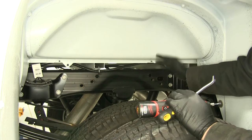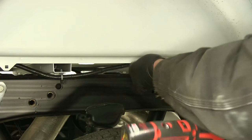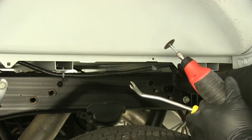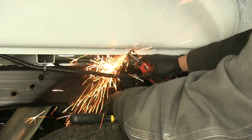We need to make a small notch here in the rear passenger side fender well. You'll see there's kind of already an area where there's just one layer of steel — we're going to take that out. This one has an electrical connector there, so you want to get that out of the way. Let that come down and we can zip tie that off right up here when we're done with that square hole, so it'll still give it a good connection point, but we want to keep that down and out of the way, especially while we're sliding our rails in.